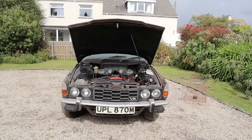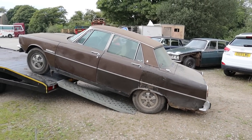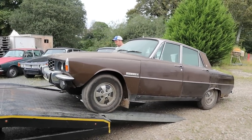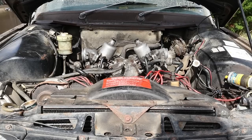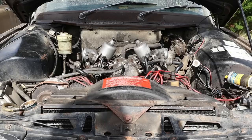Now's a good time to show you the footage of taking the rear wings off, and we'll see you when she's going on the truck. It's now time to unload her — down it comes, to join its other Rover brethren. Got four of them here now. The green Cornish car's going to scrap — it's totally knackered. Right, so we changed the coil, and little John observantly noticed that the live feed to the dizzy was off. The mechanic who last touched it probably disconnected it. I bet that coil was fine — it probably was. We'll reconnect it and see what happens now. That would explain why we didn't have any spark.